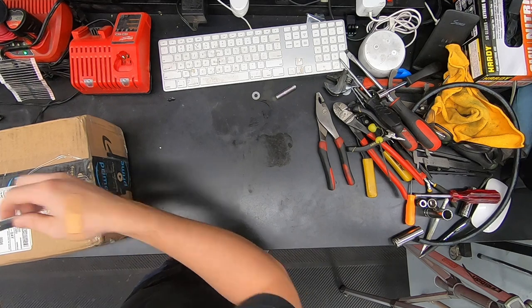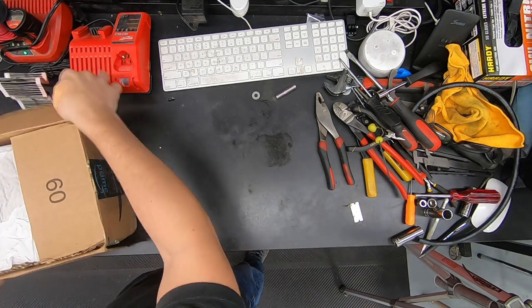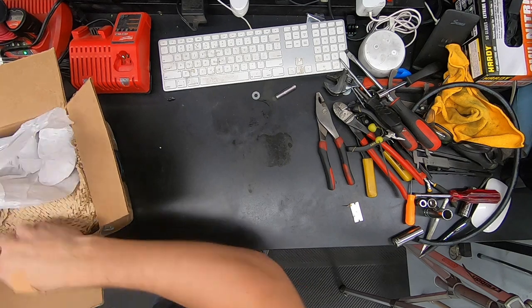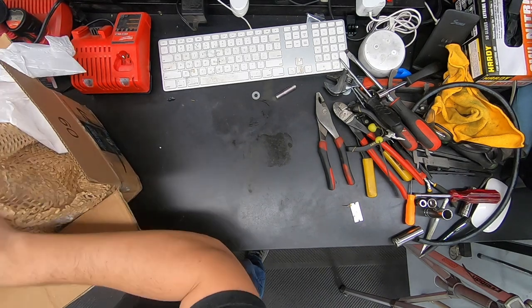Welcome back to Classic Octane, I'm Taylor. In today's video a customer sent in what I'm going to call a basket case set of carburetors — we know we're missing some parts and we're not sure the condition of the parts that are here. These should be off of an early 70s CB400F, the four-cylinder model, which makes them basically the mini version of the CB500 and 550 carbs I rebuild all the time.